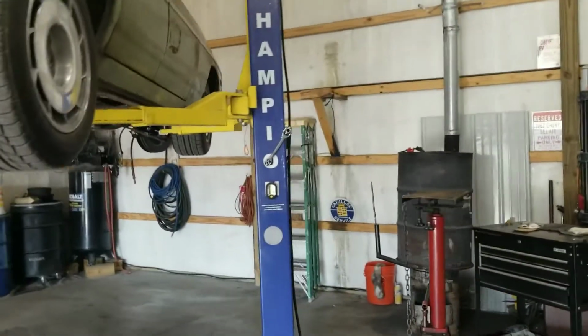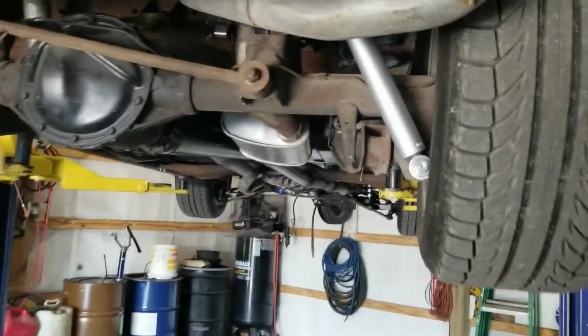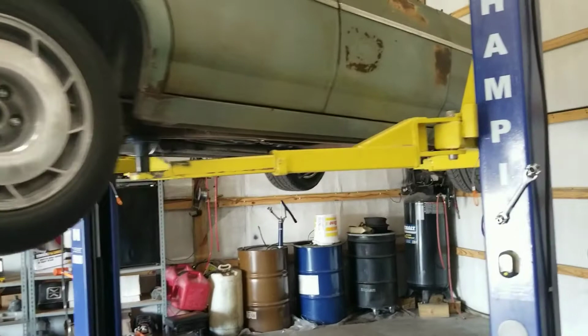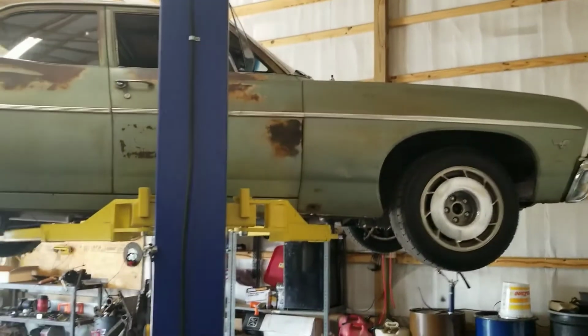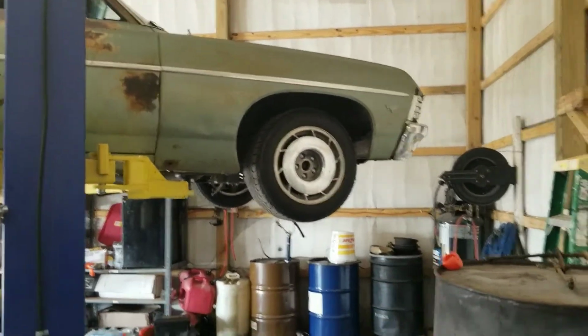The suspension works pretty good. The new shocks, which are these KYB gas adjust shocks, they ride a little stiffer, which is good. It doesn't waller around as much in the corners, stays pretty in control. The steering just wobbles around a bit because of the steering box having some play, but I'd say overall it was a success. Just wish I wouldn't have had to change the springs 3 times.